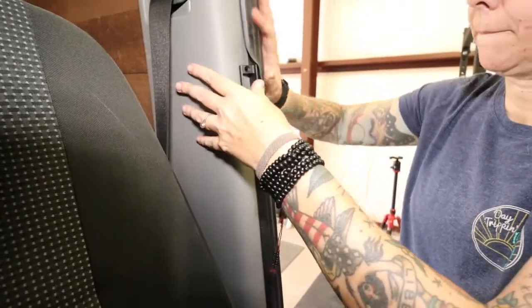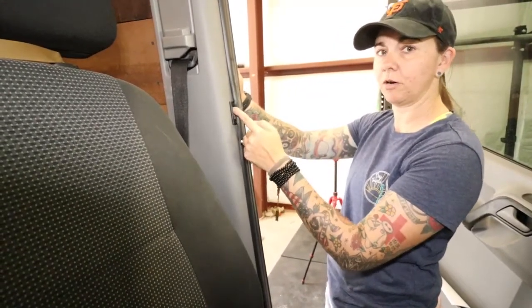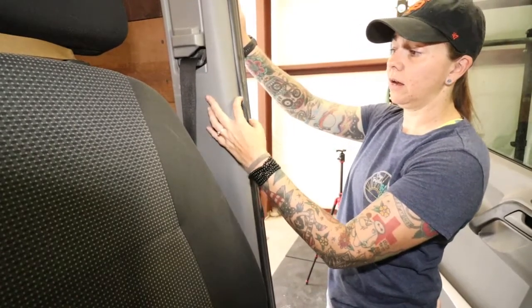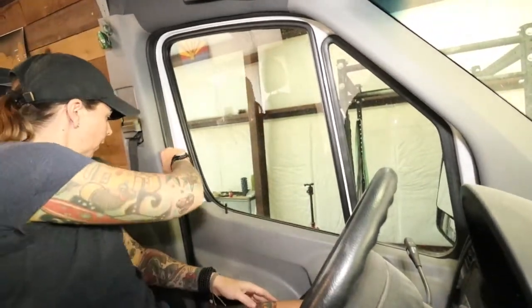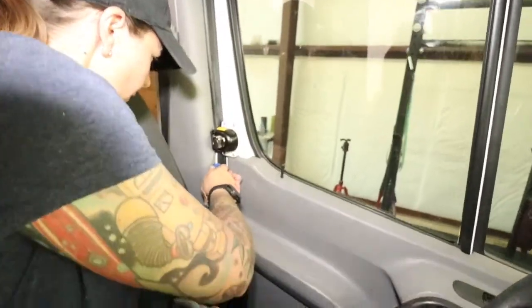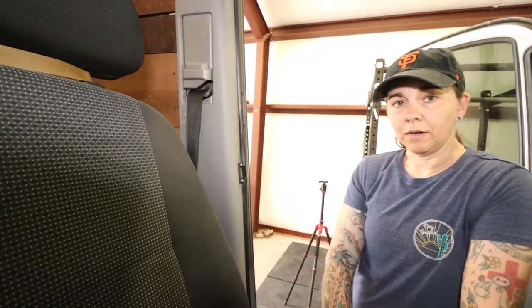The plate is shaped kind of weird — this part has to get tucked in behind the rubber seal, between the plastic of the B-pillar and the metal part of the B-pillar, so it's a little hard to wedge in there. The rubber gasket kind of covers part of it, so we need to determine exactly where it's going to go, slide it into position with the lock, and then cut out just the part where the lock is actually going to go in — so we're not removing any more of the trim piece than we need to. And that's it for the front door lock install — just repeat the same thing on the other side.